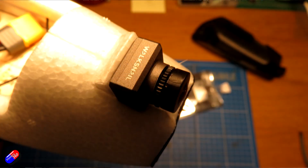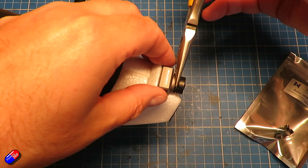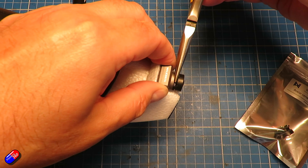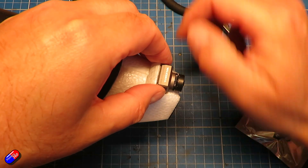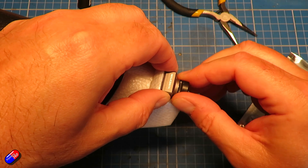Before you start, make sure the area is nice and clean and free of dust. Make sure you wash your hands and there's no grease on your fingers, because you are going to be touching parts that don't want any fingerprints or grubbiness on them. Fitting is pretty easy. Make a note of how much space there is between the locking ring and the back of the lens already installed — it helps get the new lens into the right position because the focus needs to be fine-tuned.